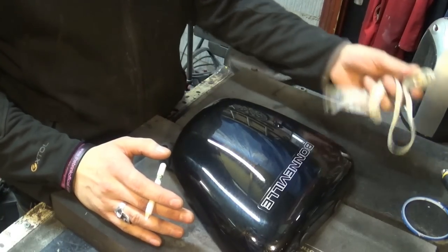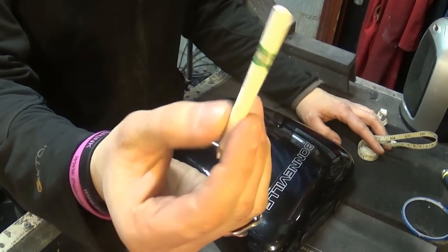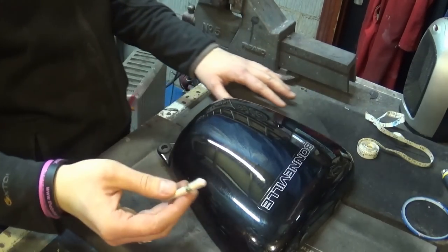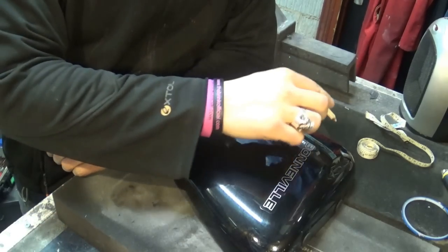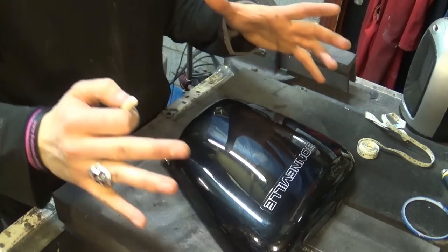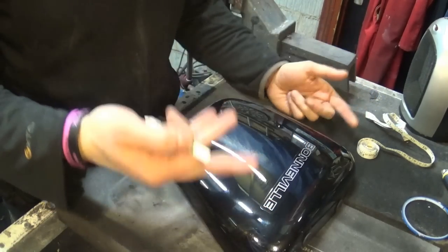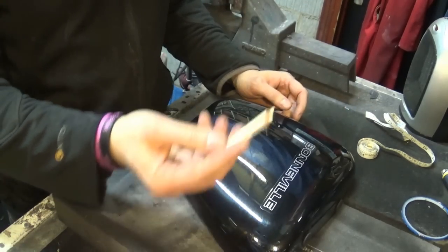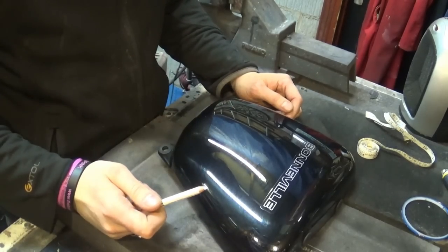So I'm gonna use a tape measure, the flexible textile tape measure is always a good idea to have, and my Stabilo all-surface marking pencil, a grease-free wax pencil, so I can mark out my roadmap, where I need to go, and compare it with the other panel and the other side of the petrol tank and so on. So when I'm actually painting with my brushes, I can focus on nice lines and not worry about where I'm going. This is where this comes in handy. So I'm gonna do it now quickly, and then we're gonna take it from there.